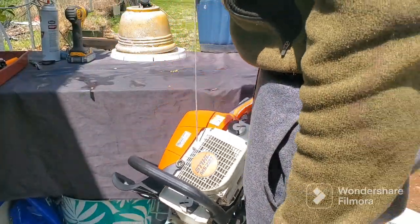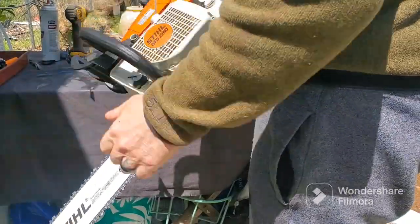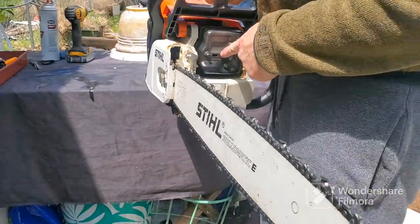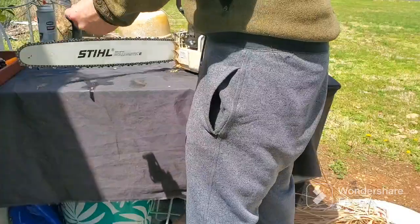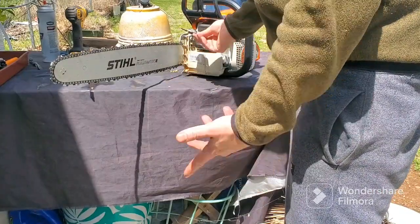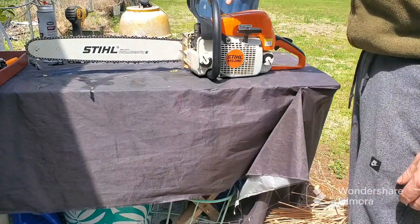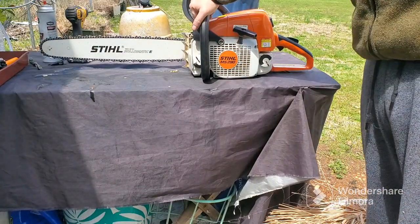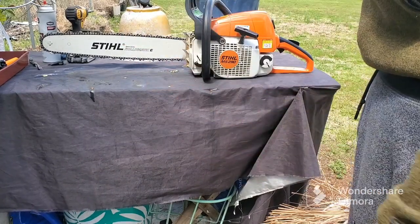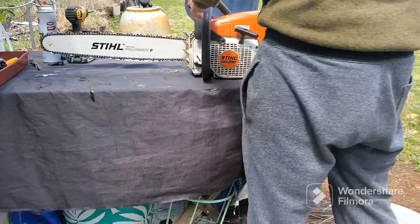That's what you want to see when you go to a yard sale buying a used saw. This is a heavy saw for the amount of cc's it has — only 57cc's. You can see it's very nice. I took the exhaust deflector off so the air comes straight out instead of to the side. That's what you want to see — and it's just too nice to sit there rotting away on a shelf because somebody said it wasn't worth fixing. Just some cheap rings. Next time someone tells you a saw has bad compression, don't give up on it — it may just be something simple. Let's go ahead and start this guy up.